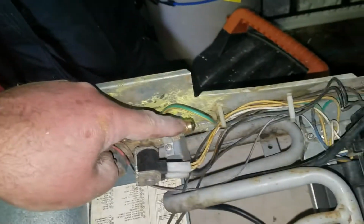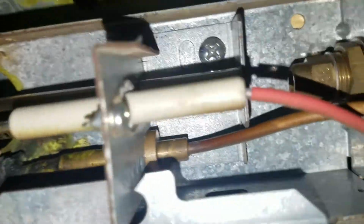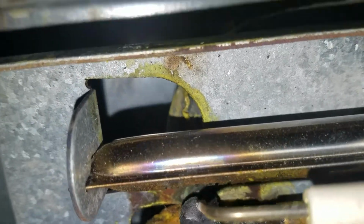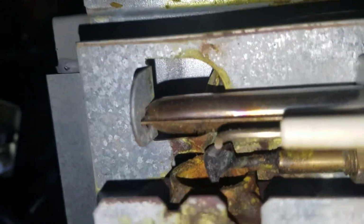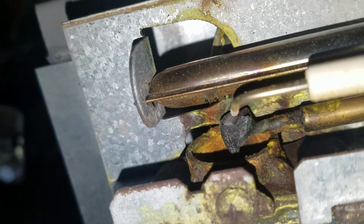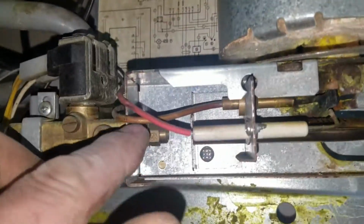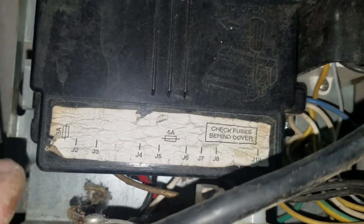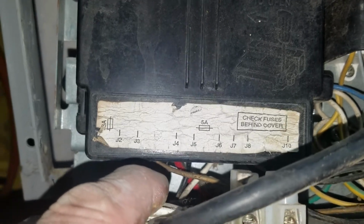But so here is the propane inlet here. Here is the thermocouple. And you can see that thermocouple is looking pretty scuzzy. That might just be from the ammonia, or it could be the way it's designed. I don't know. I'd have to see what the proper thermocouple looks like for the fridge burner. What else we got? So yeah, the thermocouple goes back through here and up into the control box there. You can just see the thermocouple wire tube right there at the end.